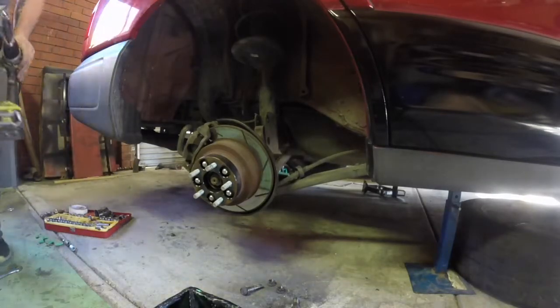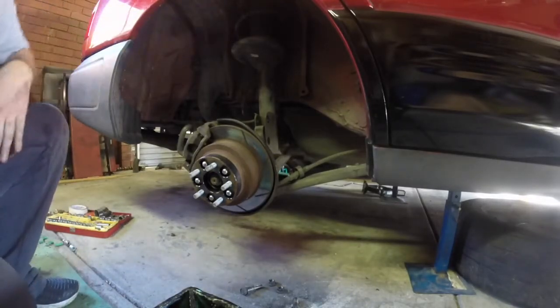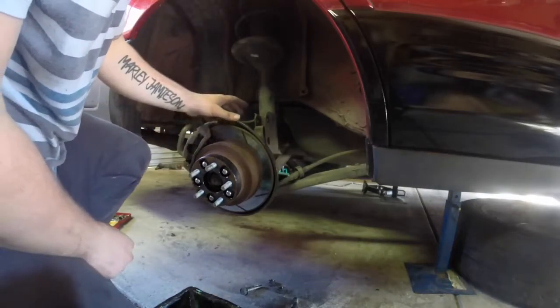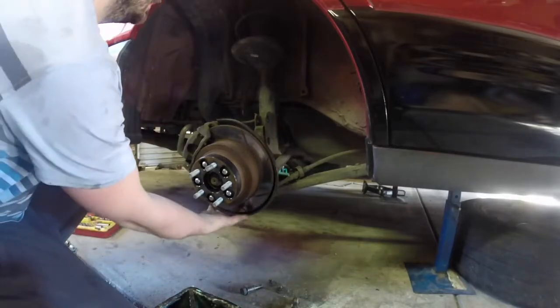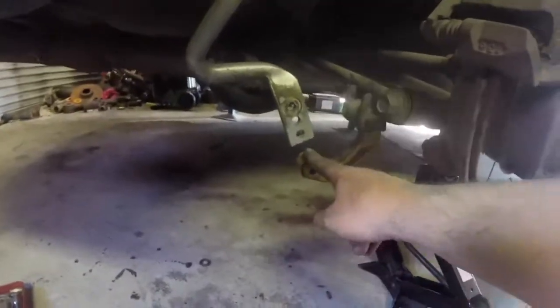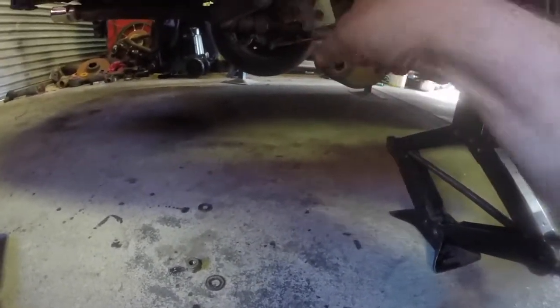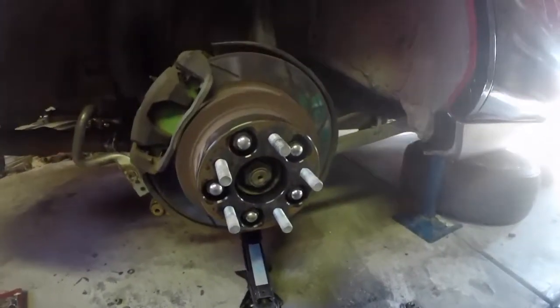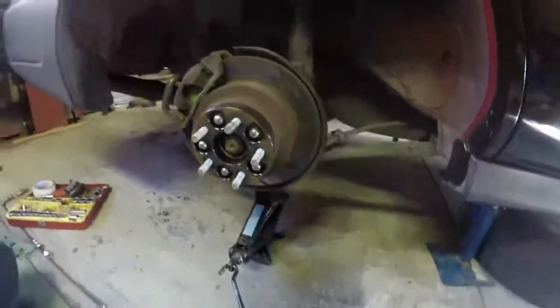Make sure you don't lose those nuts under the carpet. You would have seen that drop down a bit — it'll be very easy to pop it out now. I'm going to go get that scissor jack and just put it underneath. I've just jacked it up a bit so I can get the link off. I'm going to let that down — it's going to go pretty far down. It'll be very easy to get this suspension out now.